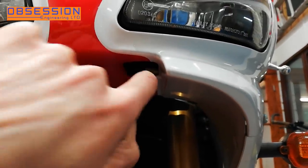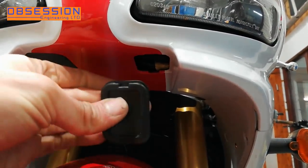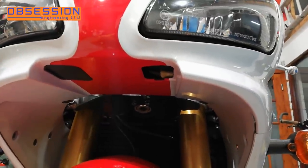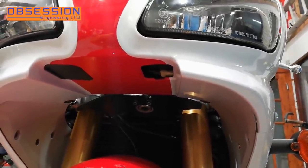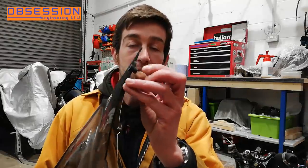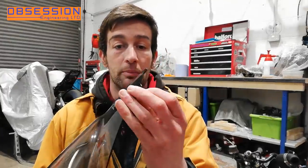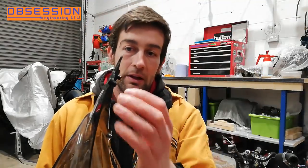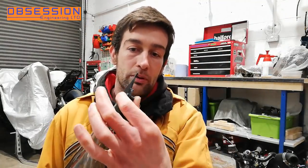And the nuts I could get through these little holes. Yamaha give you these little access panels to change the side lights, so I just wafted my finger around in there and out they came. So instead of having a nut and bolt to hold the screen in place we have well nuts. If you've not seen them before they're just a little rubber bung with a nut in the bottom, and what happens is when you thread the bolt in, this side pulls up and squishes up and stays where it's supposed to be.